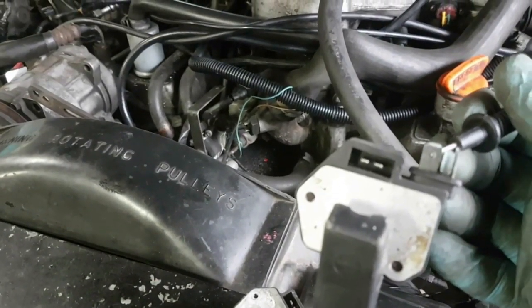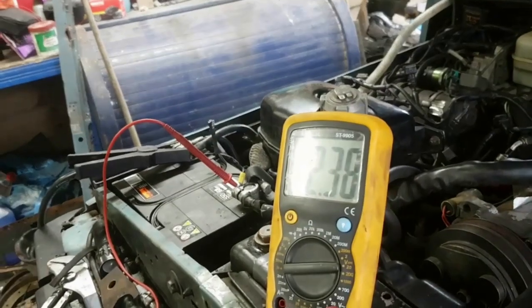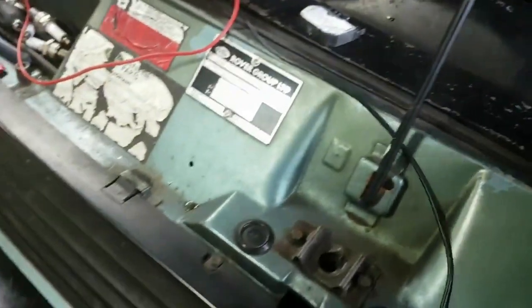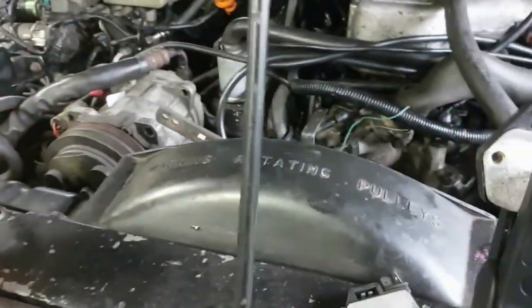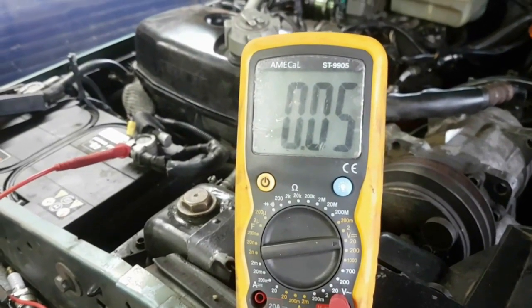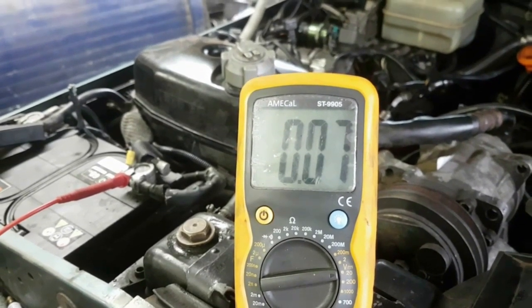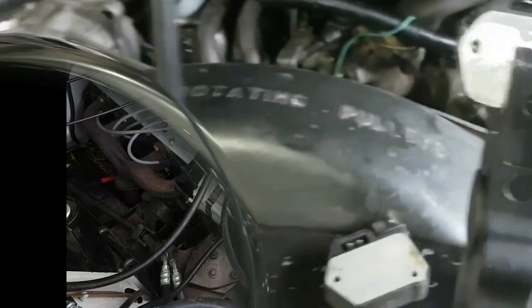We'll connect onto the coil terminal — you're getting battery voltage straight through it. That's the battery feed, so you'd expect 12 volts to go to that, but this should not have 12 volts — and it has. Now we'll check the last one, the brand spanking new one from Distributor Doctor. Voltage zero on positive, touch the terminal: 0.06 to 0.07 volts — that would appear to be okay.